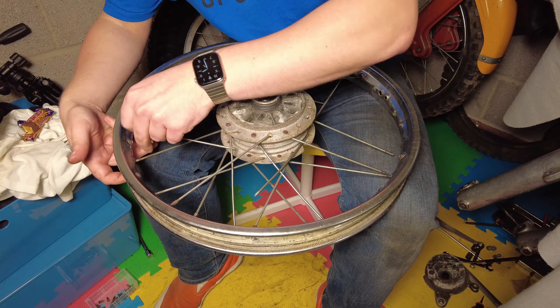Back to that James Bond thing again with the magnet. Here's the stator — inside looks all right, no big gouges or cracks or anything obvious wrong with it. It probably works fine, except it can't because the wires aren't plugged in. The state of these wires has absolutely had it — I haven't ripped anything, that's how they were. Fortunately I found a pretty good condition one on eBay marked for a C90, but I'm pretty sure it'll fit. With the continuity checked and some new terminals crimped on, it's looking pretty good.